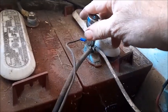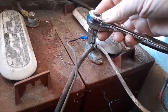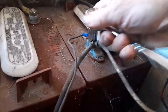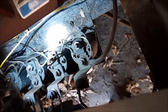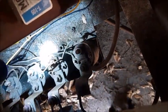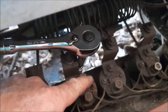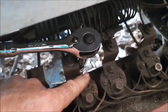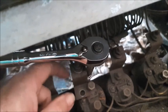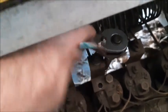Before starting to take the resistors and the solenoids off, we're going to take the lead off the battery bank so we don't have any shorts that could cause fires. The solenoids are held on with a bolt on either side, which is 7/16ths in size. It's a little hard to get to the nut on the back side, but by taking the bracket for the resistor off first you can slide it sideways enough to get your ratchet down to that rear nut.